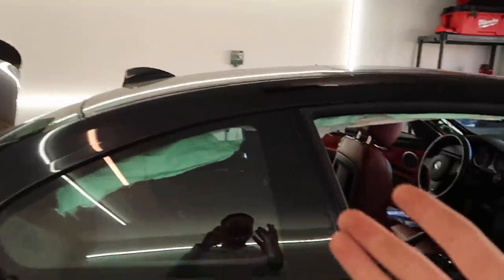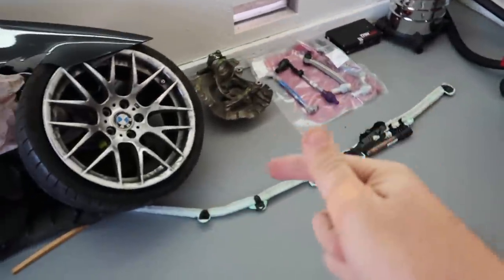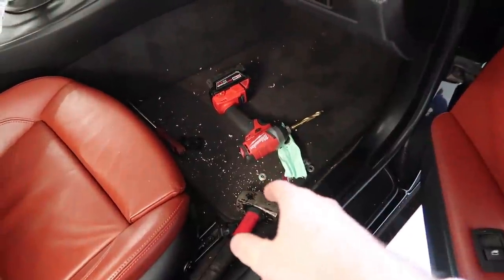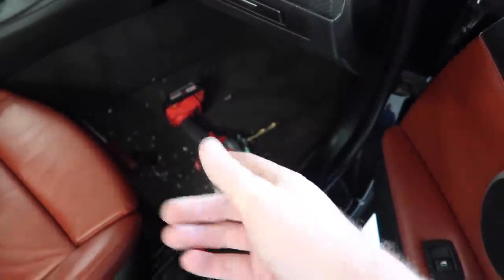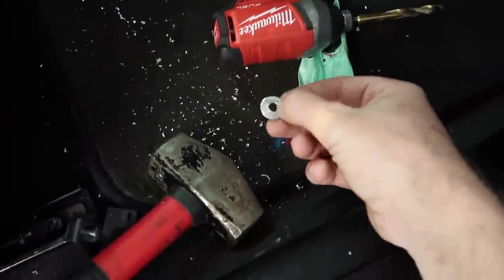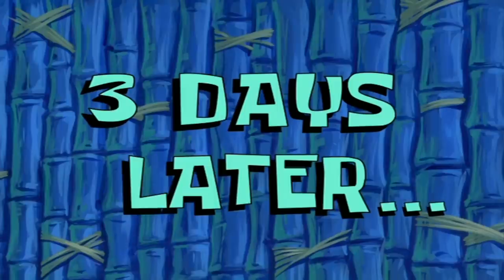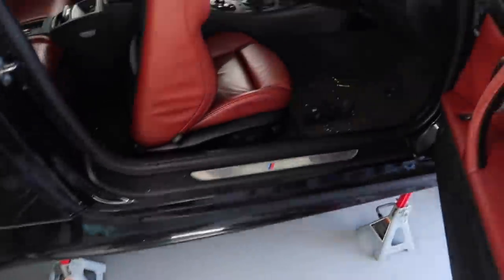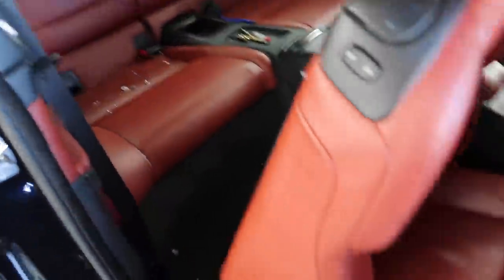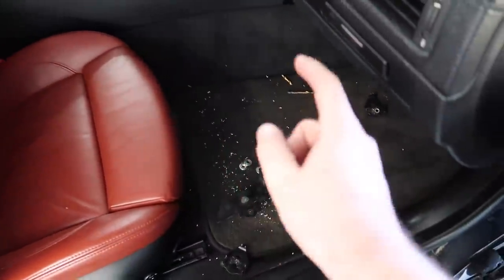Before putting any of this stuff in, of course we have to remove the old airbag. Now there's a small neat trick — actually I just remembered we have to get something to put this airbag in, so we're going to have to head out. Five hours later — so remember when I told you guys it's not going to be messy, it's going to be pretty easy? I was completely wrong. This is actually a pain in the butt. What I'm doing is drilling out the big circle of the rivet off, and then I pretty much grind off the rest of the rivet using just the regular drill. This was absolutely a mission to get off. I thought I got the hang of it, but I did not. I wish I could say it was pretty easy — this was a pain in the butt.